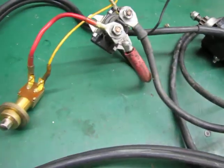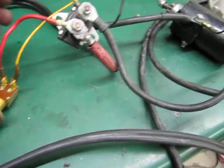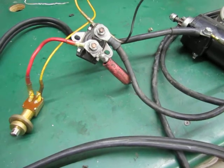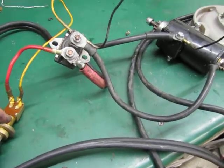You have to drill a hole through your shroud, or bring it through like a choke opening, to mount the switch, and find some place to mount the solenoid. It does not have starting gear protection or charging, but a battery will probably last all summer starting with this.